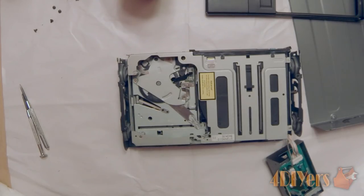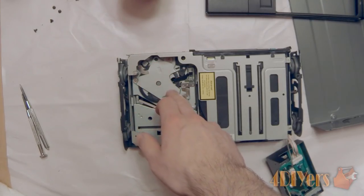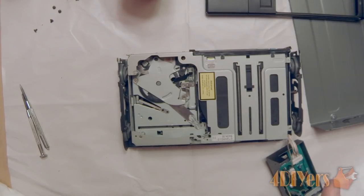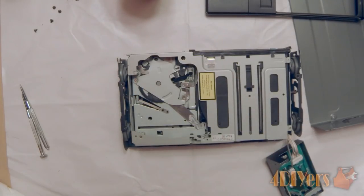For reassembly, the procedure may vary between makes and models but is similar overall. If you can gain access to the laser inside, you can use laser-cleaning discs, or use a clean q-tip with a little rubbing alcohol to gently wipe the lens — use something that evaporates fast and leaves no residue, as anything else can damage the laser. Laser-cleaning discs with little brushes can be purchased at your local electronics or computer store; you simply play it like an ordinary disc. Once fully reassembled, put it back in your vehicle and test it out. That concludes this tutorial — if you have comments or questions please post them below, subscribe, and like the video. Thank you for watching.